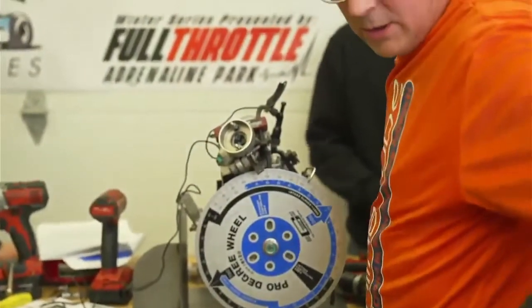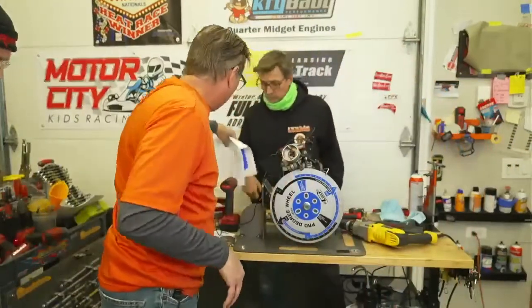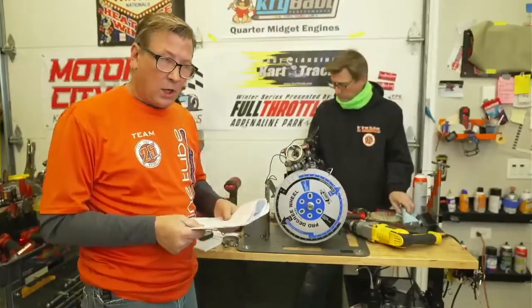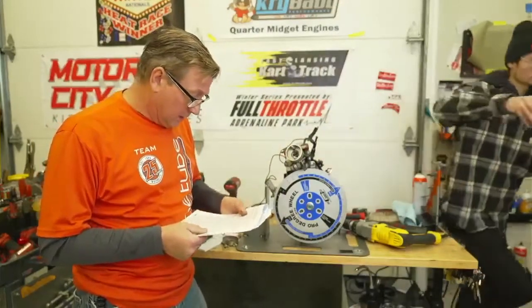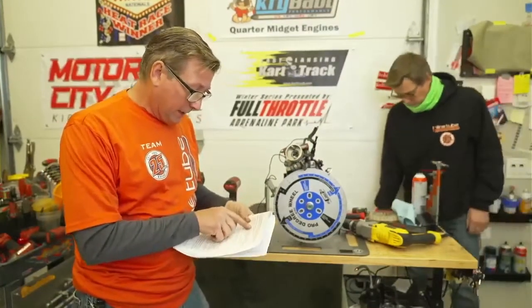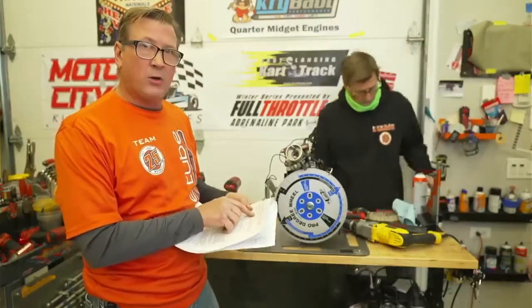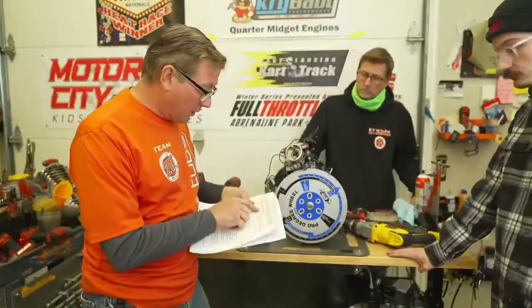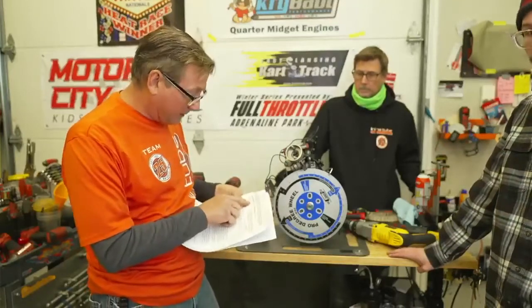Okay, do we have any questions on timing? They just agree, and why don't they have a specification of the RPM? Right. So I just want to reiterate the rules on timing just so that we're all on the same page, because this was just updated and I find it utterly ridiculous that we talk about this. It's been on the internet 4 times, okay? And it's pretty easy. It says between 1200 and 2000 RPM. Well, we just clearly pointed out that 2000 RPM is pretty hard to hold the drill and get it. It bounces from 19 to 21, it's hard. But the 1200 number, that's easy to get. You just full trigger the drill, it goes to 1200, we check the timing, we're all done.